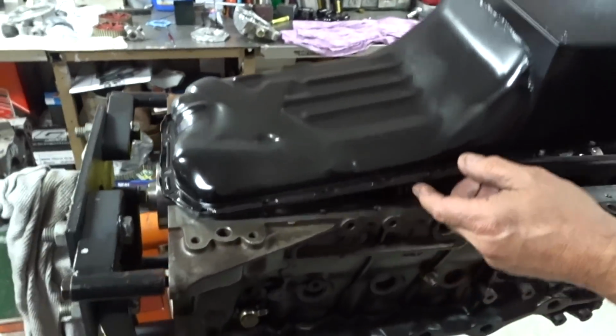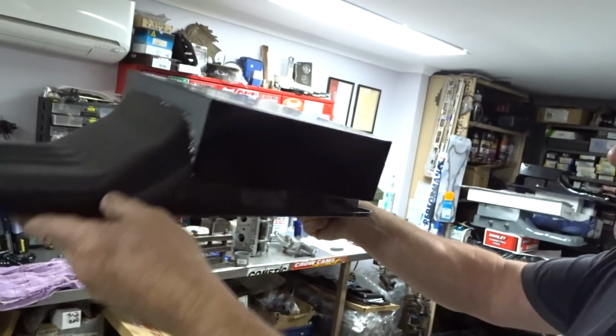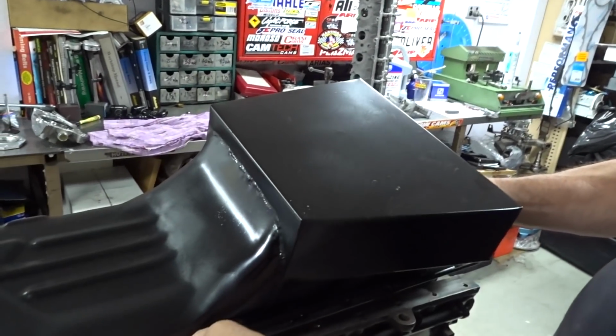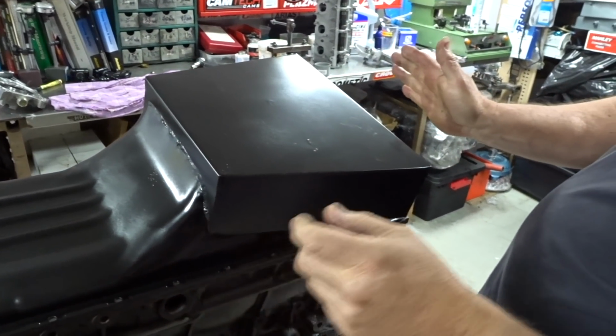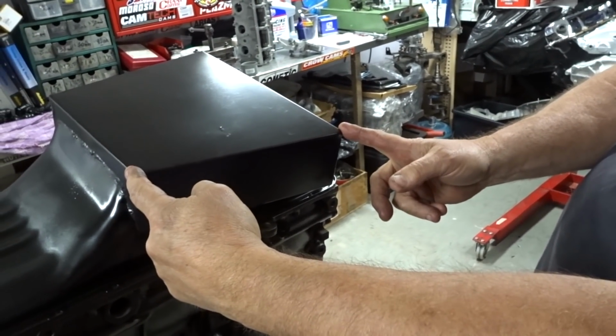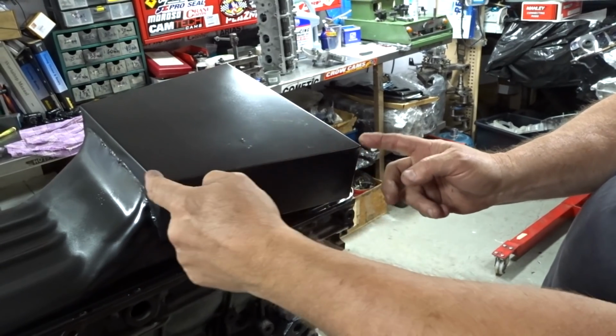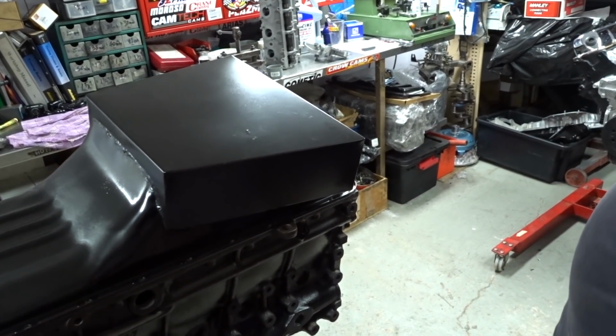So it's going in a VL, so I made that sump for it. Yep. With the baffles, you know, the same as what I've got. So the VL Commodore, their sway bars are further forward than the Skylines. Ah, yep. So you can go 250 with the box. So the Skyline box is back here. Yeah, right. So you can get a lot more oil in the VL. And that was just a Brock.